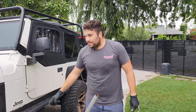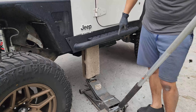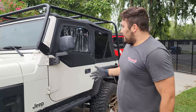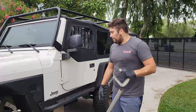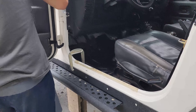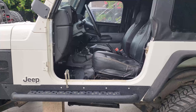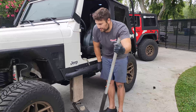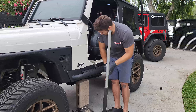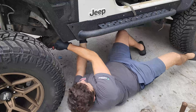We're going to go ahead and slide this in now. We'll show you exactly on the other side — I just wanted to make sure I could get this done first. I used a cinder block and a jack to jack up the front area, loosened all nine body mount bolts, and fully removed the left-side body mount bolt. I was able to quickly slide it in. Now we're going to use C-clamps so we can tap and drill out those holes. Greg has taken the door off for better access. Lower the jack so it sits a little better, and reclamp.